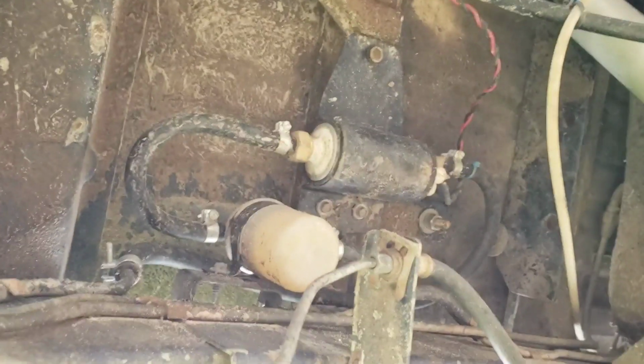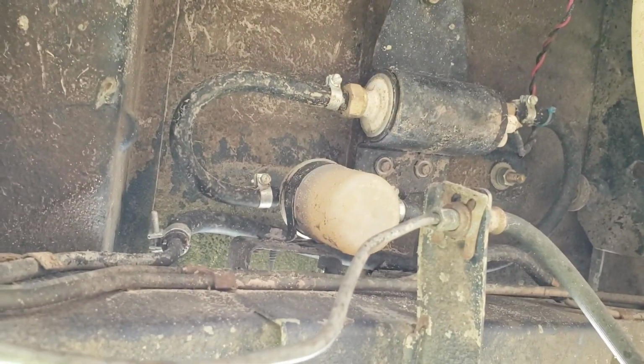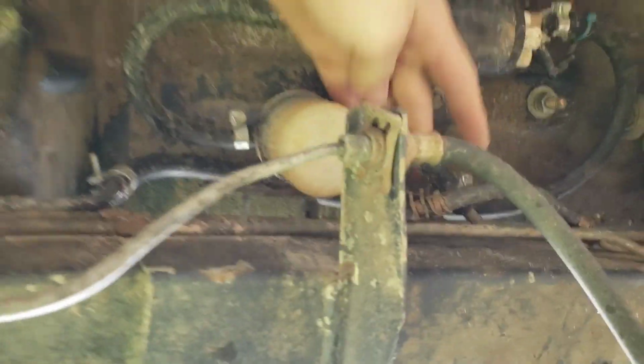So that's pretty much the motor swap in entirety, except the fuel pump, which is another thing. Ours was not an in-tank fuel pump. Ours was a barrel. So we built this bracket that has 2 self-tappers there, and it bolts in up there. And it also has a pin that goes into that hole.